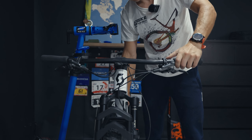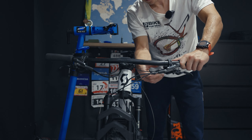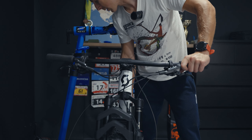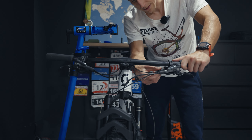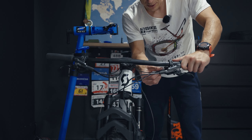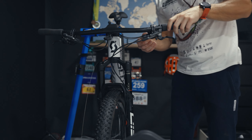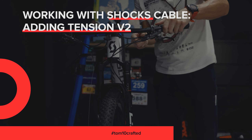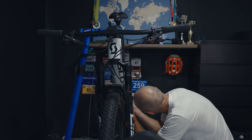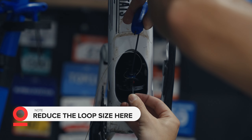Now the rear — it doesn't lock still, we need to add tension. So I guess since this wasn't cut in I will have to repeat the process made previously, because there is not enough tension and we almost ran out on the barrel adjuster. When making those tiny adjustments for the shock, loosen out the barrel adjuster once again because there was not enough tension. Release the bolt, hold the cable in place, and pull it ever so slightly.